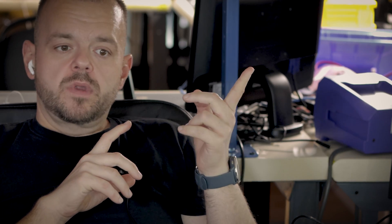I moved over to one of my workstations, plugged the drive into a SATA port on this Windows machine, and we're going to use Active Kill Disk. They're not sponsoring me — it just so happened I'm using it. I prefer Linux and I'll show you the Linux portion after. A few words: I'm sure some of you have heard that you've got to wipe the drive seven or eight times — absolutely unnecessary. All you need to do is wipe the drive once. A single wipe will write to all sectors and overwrite the data. There's no recovery from that.